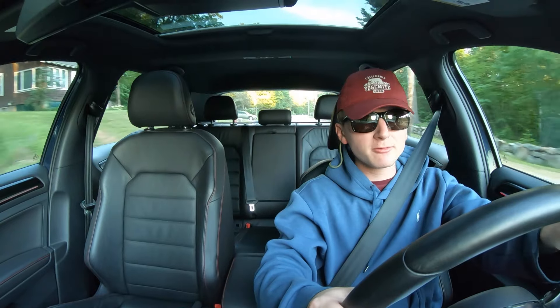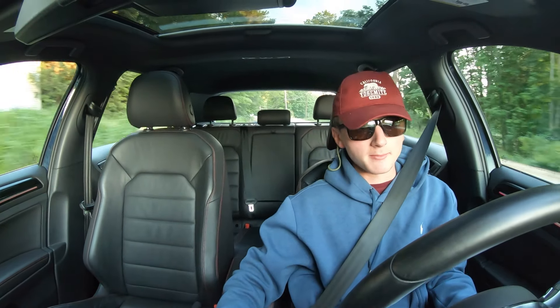I've finally set up this car in a way that I'm not worried about the clutch and can daily drive it without being annoyed with how it drives. Before I got the TCU, I was running just the ECU Stage 2 software and it was bogging a lot — the clutch just wasn't going harmoniously. Now I have both tunes, the ECU and TCU, and they go hand in hand.